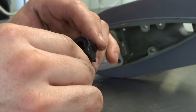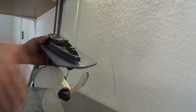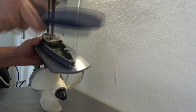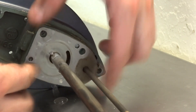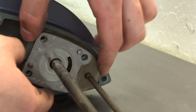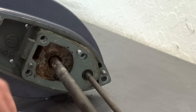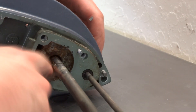Before you think you've solved 100% of the problem — this is definitely the problem — inside here there are more pieces gunked up. I'm going to tap it down to break the seal. In order to pull this plate up, you have to take the locking key out of the drive shaft. Pull it out and don't want to lose this — set it aside, it's a very important piece. Now we can slide it up and you can see all those pieces of rubber that would be getting stuck up all over again.